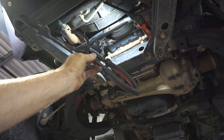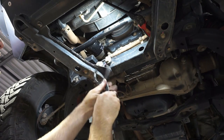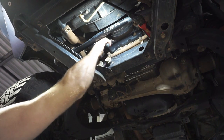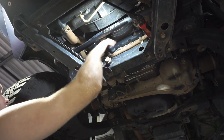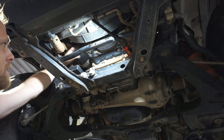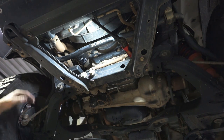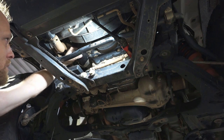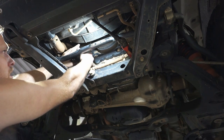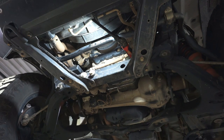I've got this little oil filter removal tool so I can take the oil filter off. I'm just going to loosen that filter off and start draining it. This tool pretty much just clamps around the filter and then you're able to turn it so it grabs on. Spin that off anti-clockwise. Now I've loosened that off, I'll move this drainer over - there's a little bowl here that the filter drains into and then a little drain tube so it comes down nicely into the oil drainer. You can loosen the filter all the way off and bring it down - there's the old oil filter.